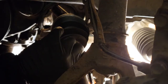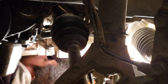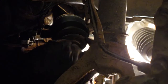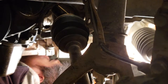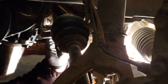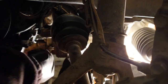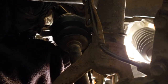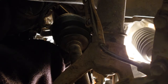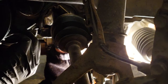That's it — a little bit. Line up the bolts, line up the hole, the bracket — line up to the block. Just check here, make sure you're in there. Give it a good hit again. That's good. Put the bolt in — one on the bottom, two on the top. Make sure you don't cross-thread this bolt. I've seen a couple of vehicles where it's not tight all the way because it's cross-threaded. Make sure you lift up the bracket — CV axle, lift it up while you're spinning the bolt.